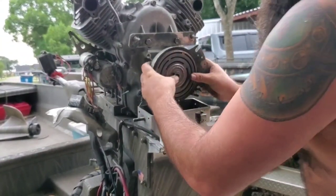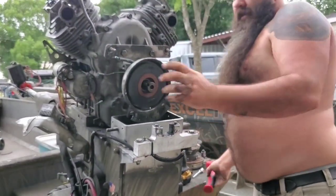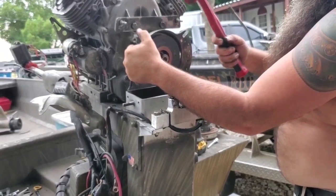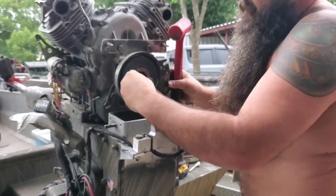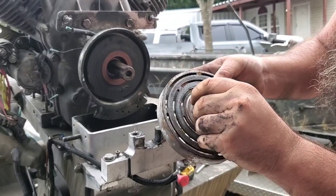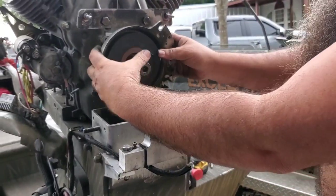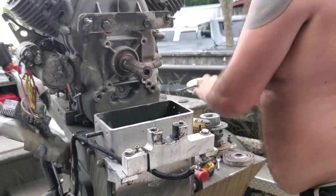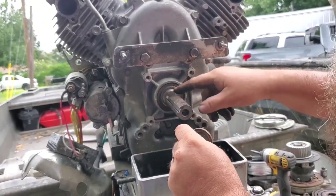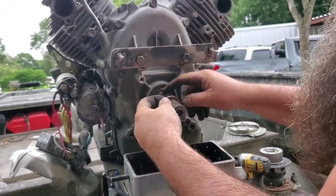These are never going to be real easy to get off. If you have one stuck, you pull on this end and tap it right here with a rubber or plastic handle. Now this is the keyway for my clutch basket — you've got to make sure that goes right back in there. What I normally do is put a bit of grease on it to hold it still so we know what goes where. Your spacer right here keeps the space between the crankshaft. This is really important — it has an angled side that always goes toward the roll on the crankshaft.